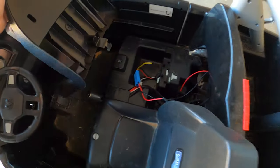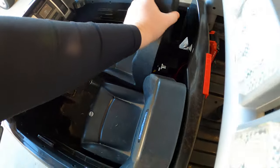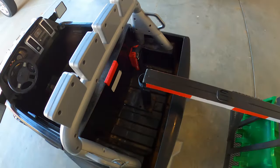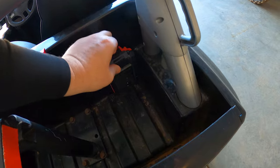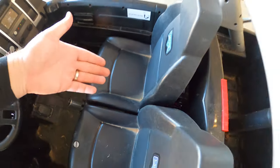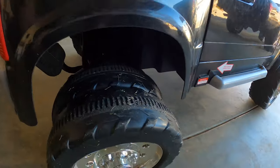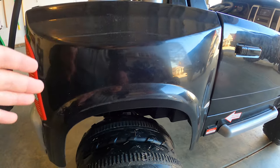One of the biggest pain points with a setup like this is finding the right place to mount the base. The way the seat is set up, it's really annoying to screw it on and off every time you want to change the battery. We figured the best way was to mount the base in the back — Mason's four years old and he's able to change the battery out no problem, so we don't have to worry about taking the seat on and off. If you blow a fuse, it's easy to change — you can get straight to the battery leads right under the wheel.